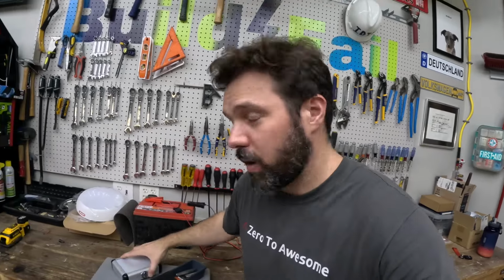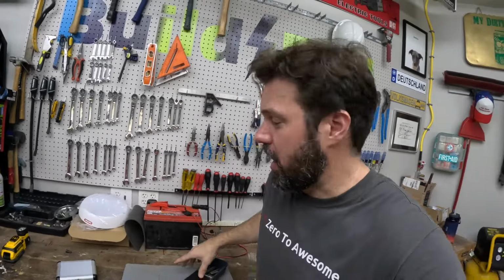So these, pretty simple, you put them in a drill, you put them on a wrench, you run it in reverse, it bites into whatever is stuck and hopefully backs it out without having to weld a nut onto it and get it out that way, or worst case, having to take something to a machine shop and embarrassingly pay someone else to undo your horrible mistake.